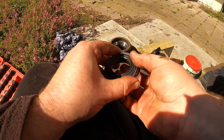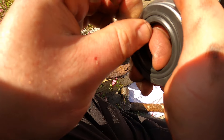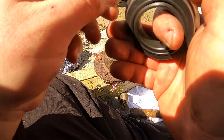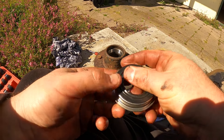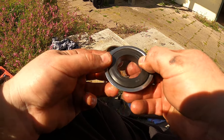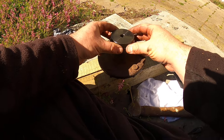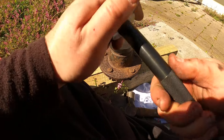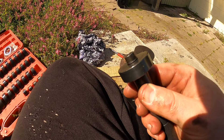Just push the seal in here. We've got to get this seal - it looks like it's gone a bit too far, just a tad. So what I'm going to have to do is push that back in. That's your seal - that's the seal dump. What we need to do now is drive that in there. I've got a bigger driver here - yeah, we can use this to drive the seal in. I'll just undo the screw and swap the attachment.